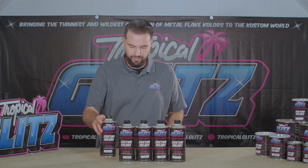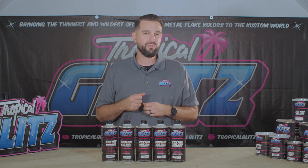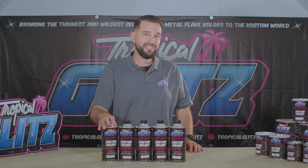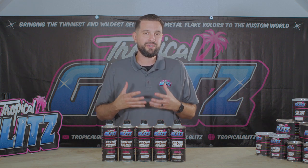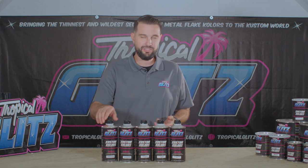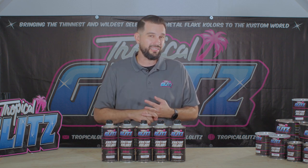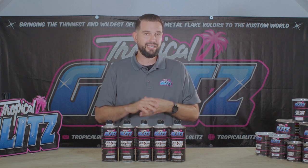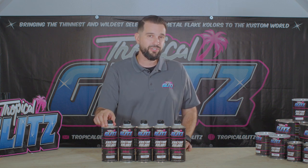This is what you start adding when you're doing multiple layers of artwork. You want to protect your artwork, have a little more chip resistance, and avoid any bleed. This is designed to have a faster dry time so when you're doing your artwork, it sets up quickly and you don't have to worry about anything from your previous paint jobs or artwork coming back up. Great places to use this are candy patterns when you're going to tape over them — anything with candy and multiple layers where you're worried about bleed when you start shooting your clear coat, and for pearls.